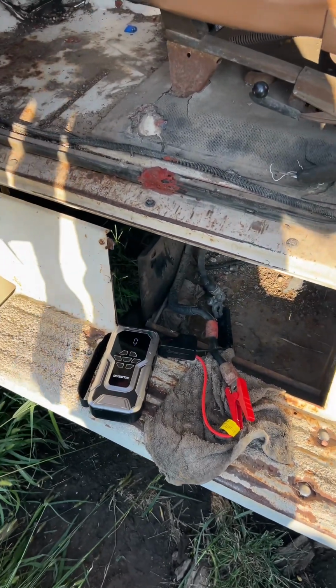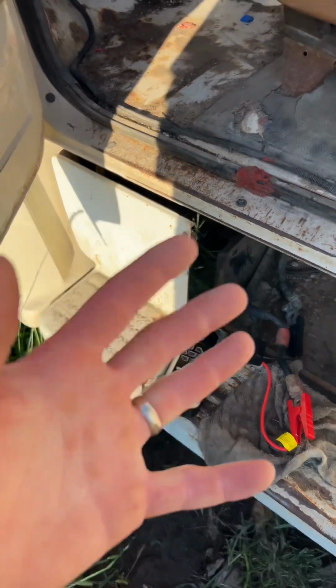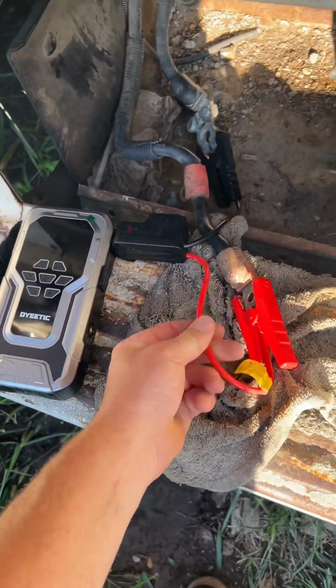So the truck dies just because the alternator is not up to speed to excite the alternator. You get the point on that. I mean, if your alternator is not working, it's going to die. This thing switches over at 3 seconds and it's done. It shuts down to protect itself. Great feature, I think. Otherwise, if you keep cranking it, you'd burn these cables out.